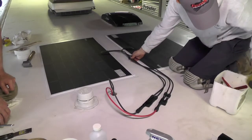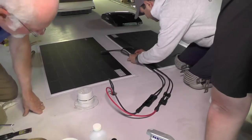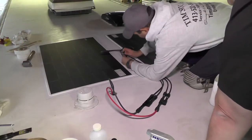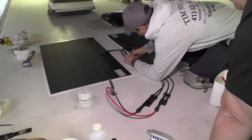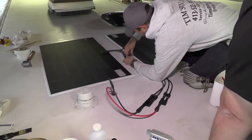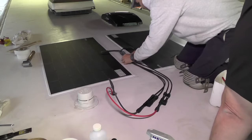Again, you'll want to take your time doing this and make sure you have things nice and tidy and well secured. As far as cable clamps are concerned, you should use metal ones that are wrapped in plastic or rubber. Do not use the straight plastic ones. They're not UV stabilized, and they'll fail pretty quickly in the roof environment.